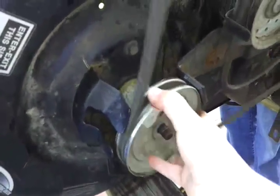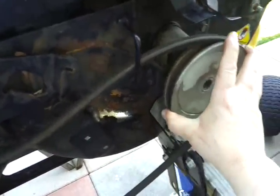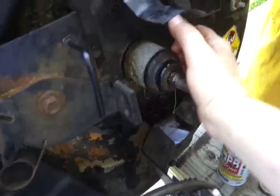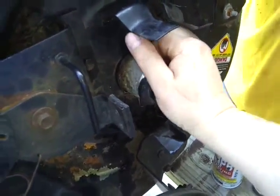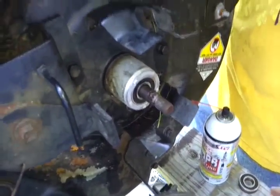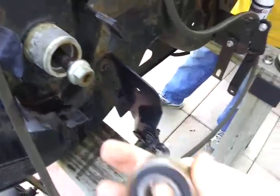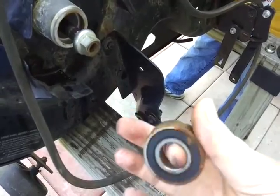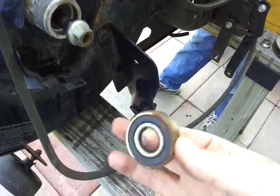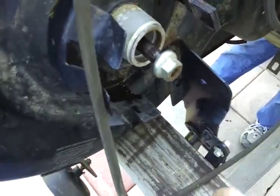This is the first time I've tried to actually take this off. I should probably go ahead and remove the belt, but it's not really in my way so I didn't worry about it too much. This right here has got a little rubber lip on it and you just pull that and it comes off. To get the bearing out — we already got this side out — and actually it feels pretty good. It's not grindy, doesn't have any problems. You can push on it side to side and it doesn't grind. It's actually a good bearing.